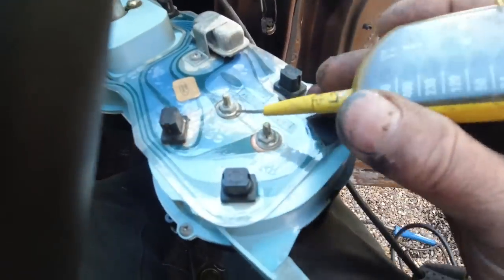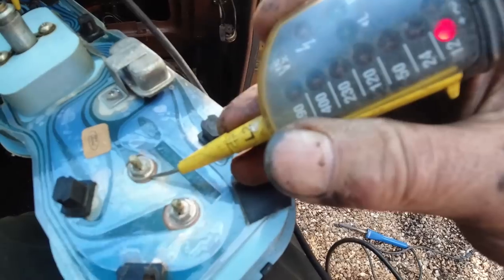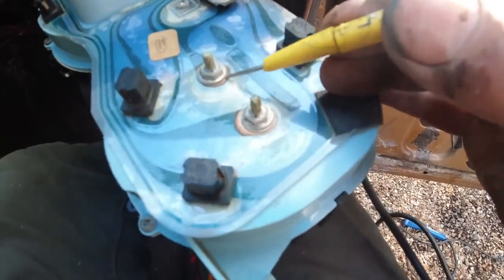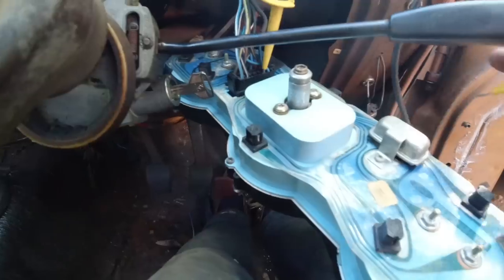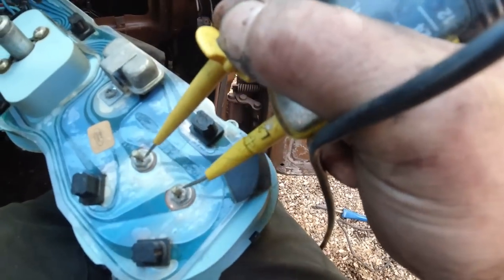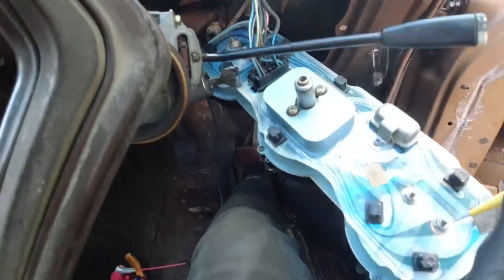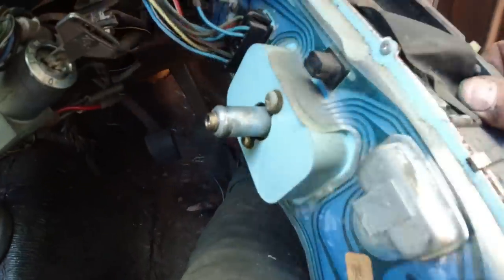But we haven't got the pulse light this side. Oh, we have now. We didn't have. So these bolts are corroded as well. So we've got a double fault, and not only that, but I don't even think the earth's making it either, because if we've now got 12 pulsing on that stud, given that the gauge has been grounded out, and I have tested it, that it is ground, the pin's not making it to the bolt, so there's a break in the track. There has to be a break in the track.